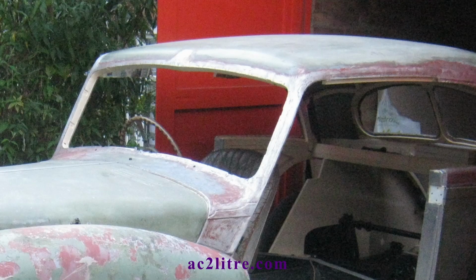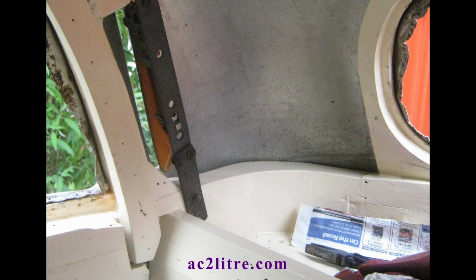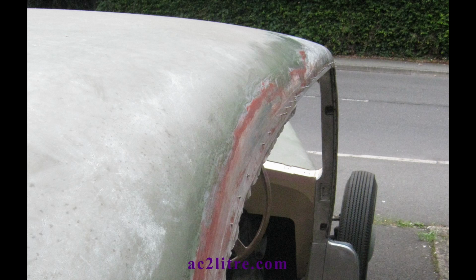My efforts were encouraged by all the nice people stopping to admire the car. I think the paint I'd applied to the frame was causing problems in regions that were very tight fit. I sanded part of the rear shelf assembly where the shell was touching it, just below and to the right of the rear windows. I also sanded the wood along the right-hand cant rail. This helped, and the front of the shell dropped down almost into place.